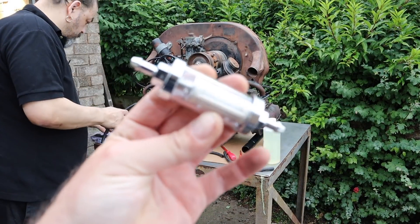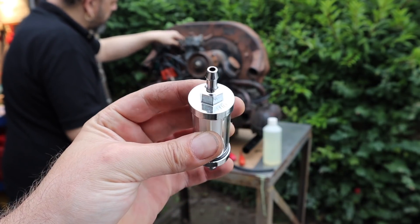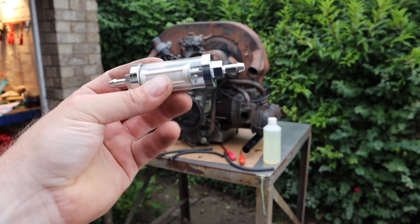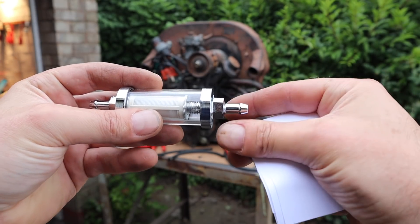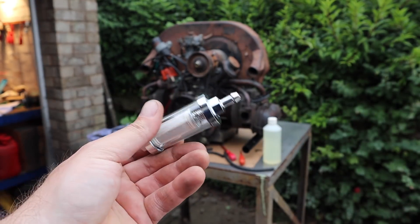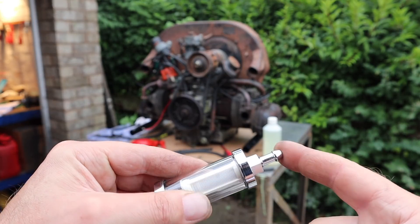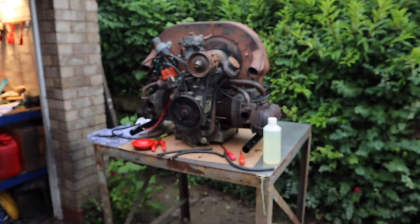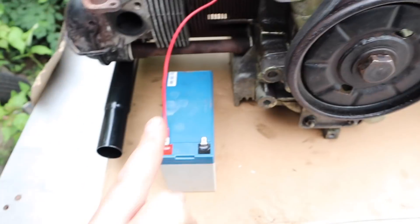I've got these — it's an inline fuel filter with replaceable elements. This is for a 6mm system, which is our ICT carburettor. I'm going to put a link for one of these in case you guys like them. It unscrews, you remove the filter element. I don't know exactly how much it costs but you get replacement elements — I'll put a link in the description. Glass and chrome, not plastic — it's proper glass. It's cheap metal but it works; I've had one on for about a year. Put the fuel filter on, fuel hoses on to the pump, to the correct port of the pump, and we've got the battery charged.